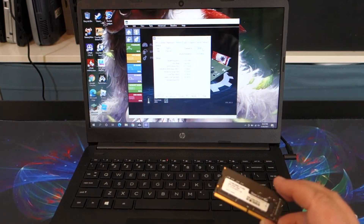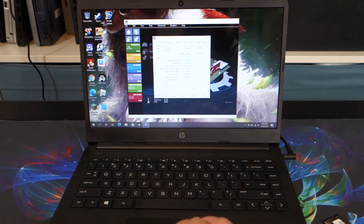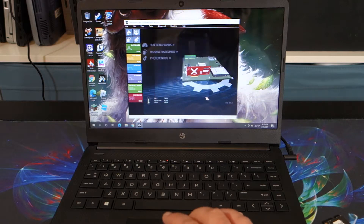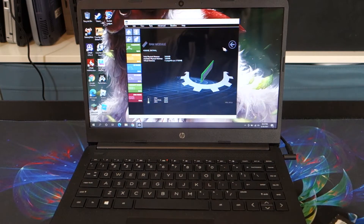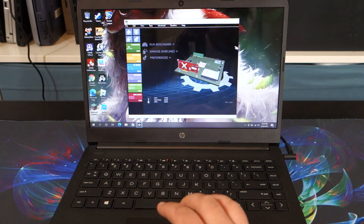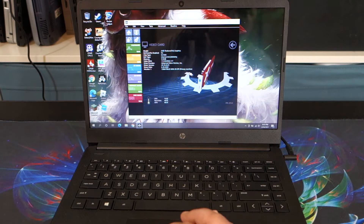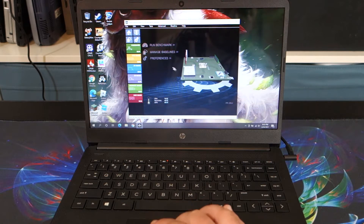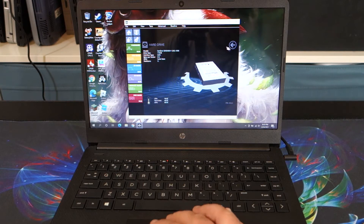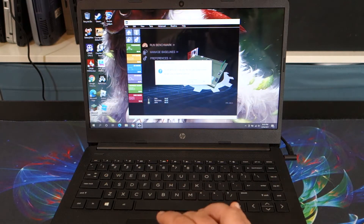Manufacturers are smart enough that this will run in dual channel up until it hits eight gigs of consumed memory. Then once it spills over that eighth gig, it switches back to single channel - that's actually kind of a cool thing. Physical memory is 4 gigs at 2667 megahertz, which is 2666. Timing will be the same. It has 512 megabytes of RAM for the graphics card. We also have the 120 gig SanDisk, a typical SATA drive in here. It does support NVMe but it just has a SATA drive for now.